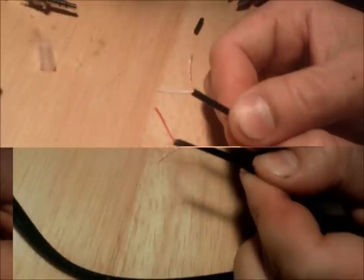Okay, on this particular Boss ATV stereo radio tube has two black wires, and if you strip them back, you'll see two insulated wires. In this case, it was a red wire and a white wire, and then there'll be copper. Each of them will have a bunch of little copper stranded wires that run all around the outside of it. Take all those and twist all the copper wires together, and then strip back about a quarter of an inch or so of the white wire, and then a quarter inch or so of the red wire, and that's going to be your left and your right speakers. And then the copper is going to be your ground. Then take a little bit of very fine sandpaper and go over the copper wires just a little bit, just to make sure you got a good clean connection for the solder.